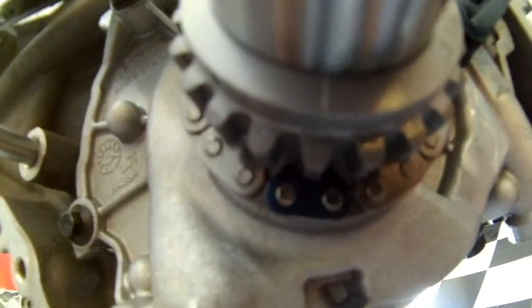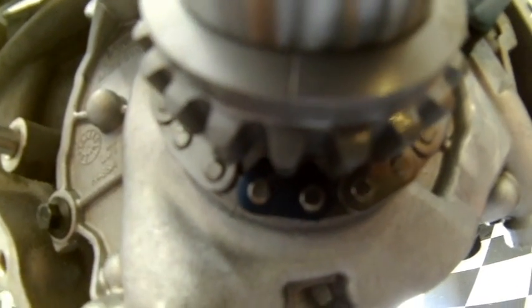You can see that we've lined up the chain mark with the mark on the timing sprocket, and we can follow this back up and see that the mark on the chain also lines up with the mark on the sprocket. This should be the sprocket with the L for the driver side, and you'll repeat this process on the other side using the R for the timing mark on the sprocket.